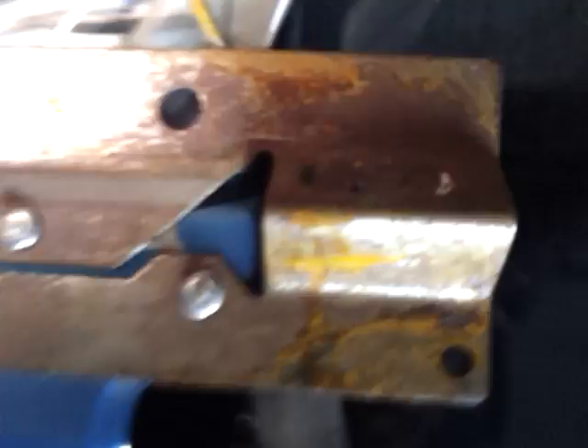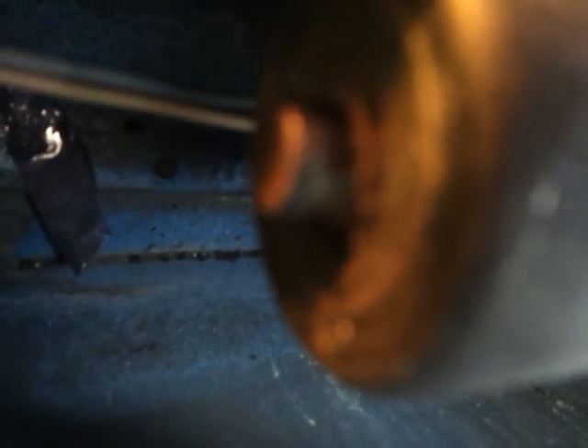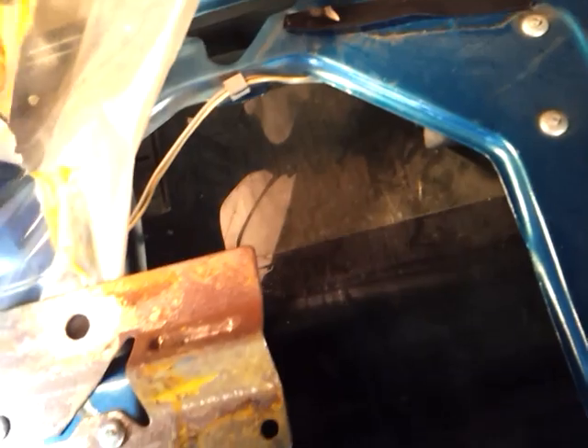Now, in this car, let me show you how it looks in there. This is your power door lock motor. This activates the lever up and down when you hit the switch. The connections down here — this is where your tan and gray wires go. Under there there's a clip. I'll show you how to get that out. There's a clip that you hit the tongue underneath, you push it up, and you pull it out.